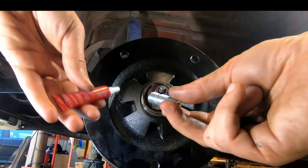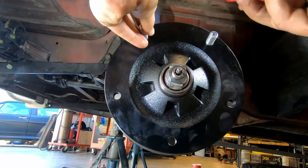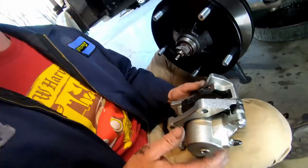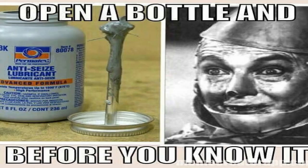The new kit comes with studs, so we're going to put a little red Loctite on there so they don't come out. A couple of things: they've got this little spacer that just keeps pads in place during shipping, so this needs to come out. You laugh, but crazier stuff has happened before. This little jewel just slips on here and there are two bolts that need to be run through. Put a little bit of silver paste on those bolts, and they go to 29 foot-pounds — it's in the instructions, so you can't miss that. They thread in nicely too.